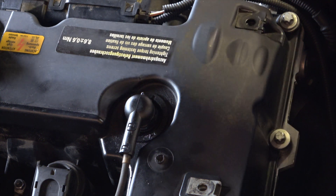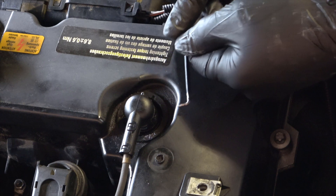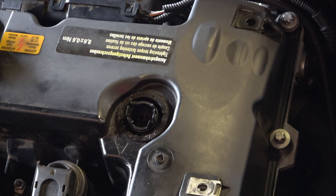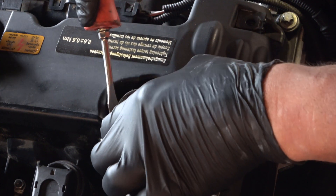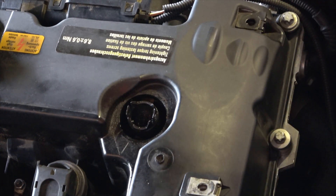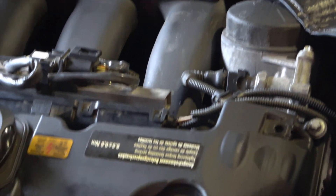To pick this electrical connector off, it's kind of an unusual cannon plug type. This is going to go way easier than I expected. That's the old sensor. You can see the tears in the sensor — that's what was causing the vacuum leak into the motor. I'm going to grab a rag and a flashlight and make sure we don't have any rubber bits stuck in the engine.